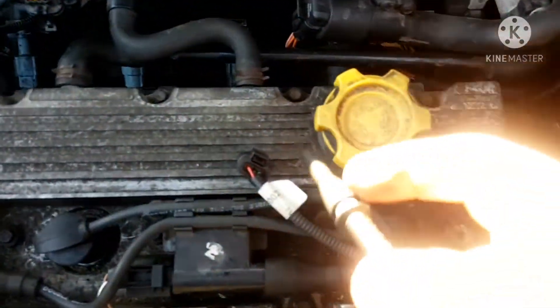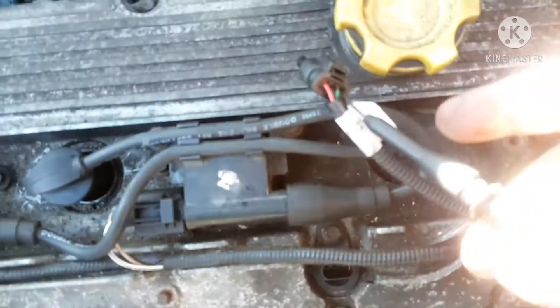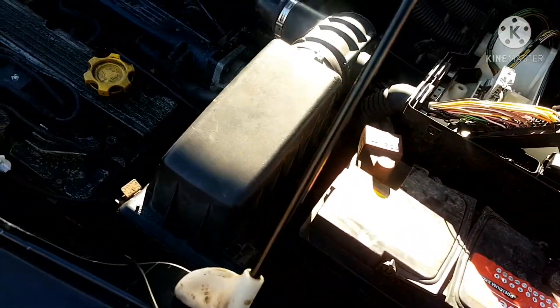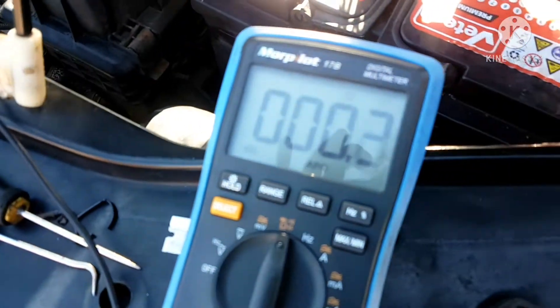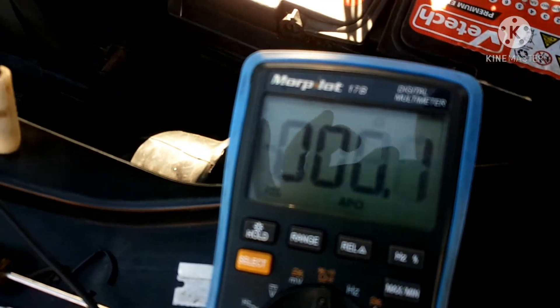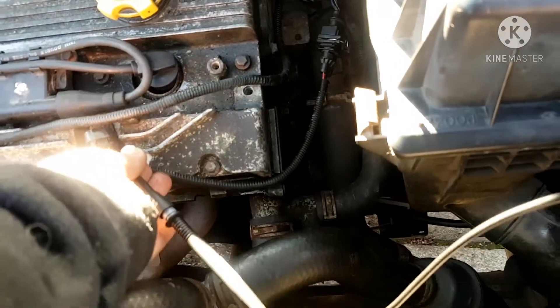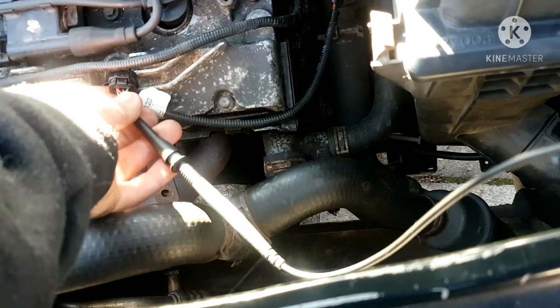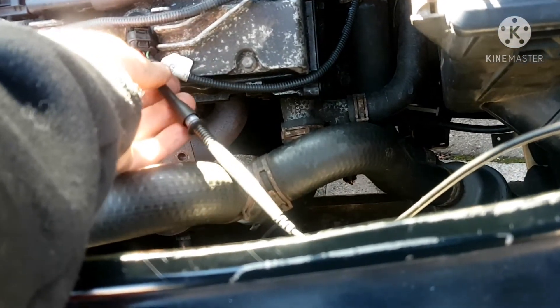What we're going to do is back probe it. On this one there's a green wire here — we're going to back probe into there, one-handed. We're going to go straight in. I'm only touching it, I'm not pushing in. We have resistance in that, so that's looking good. I know my ground is good. I've checked my ground through the battery positive and negative — that was fine. The signal seems to be implausible, so I'm going to check the power side as well.